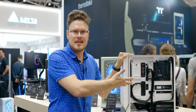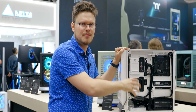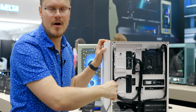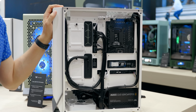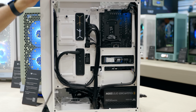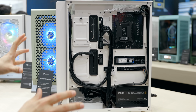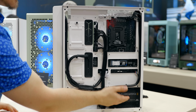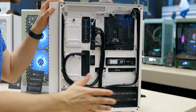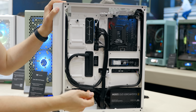But the concept is brilliant, because what it lets you do is reconfigure all your cables from the back side without needing to access the front. So number one, replacing the motherboard, replacing all the cables becomes so much easier. But number two is that you can actually complete a very good, clean cable management job on the back, while everything on the interior in terms of cables is totally hidden. And that's brilliant because the power supply is not really affected as long as the cables are flexible.